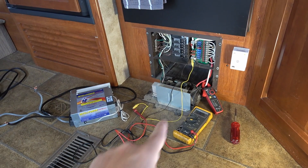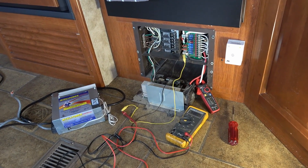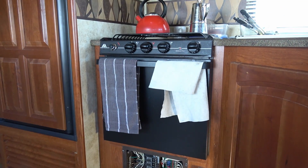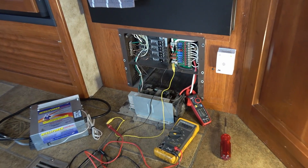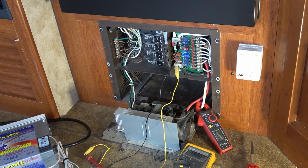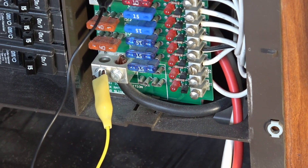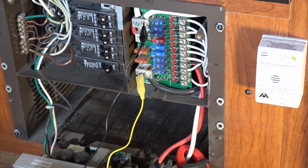Anyway, what I got here right down there is my OEM charge converter — that's basically the battery charger for the rig. It charges the battery which is actually located at the front of my fifth wheel. This charger is actually located underneath my stove, sort of towards the rear of the rig. So the cabling that goes from this charger out to my batteries runs anywhere from 25 to 30 feet, and it's not the most heavy gauge cable — I think maybe it's a six gauge.